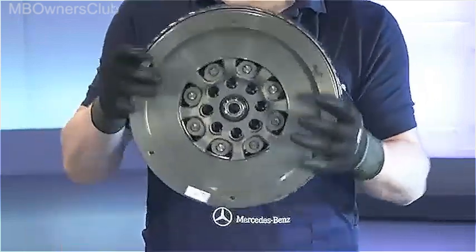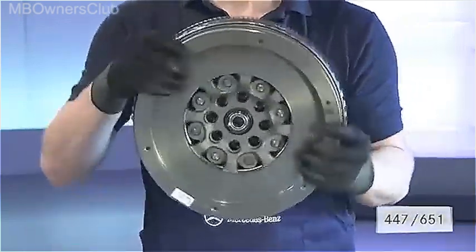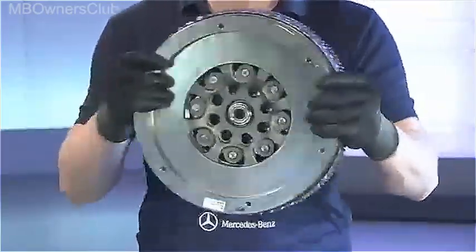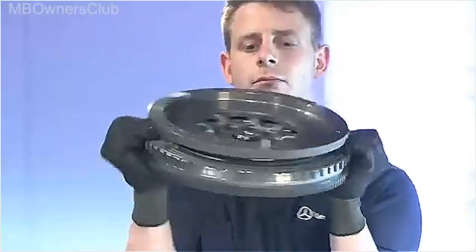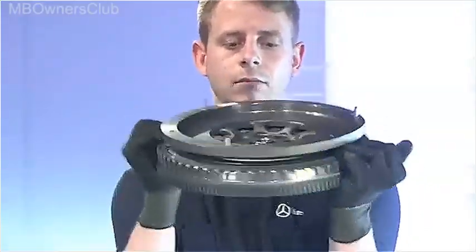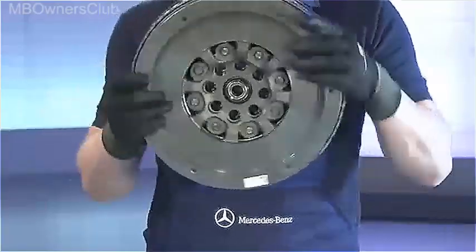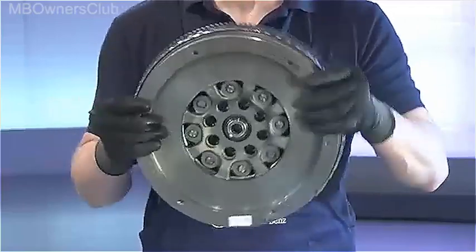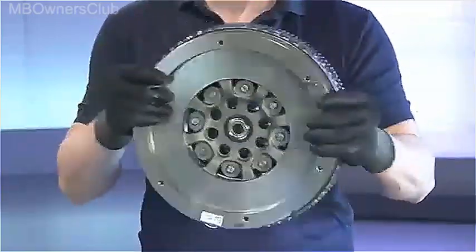Here are the completely normal noises caused by the movement of a dual mass flywheel. These noises are generated by the centrifugal pendulum and are especially audible when starting and stopping the engine. These are not a problem and no reason for complaint.